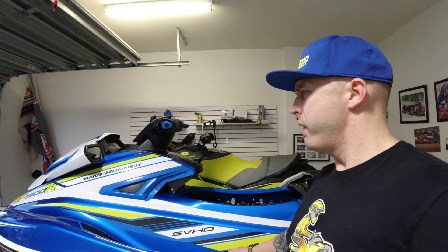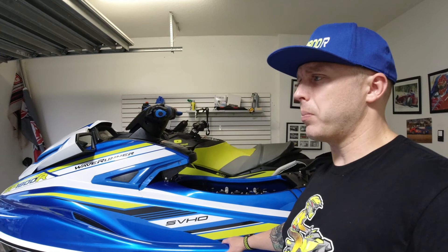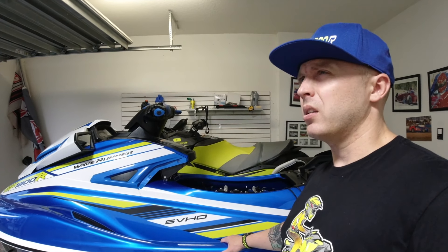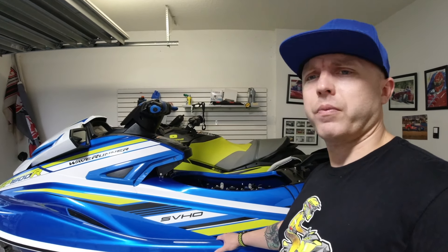In stock, these things run 68 miles per hour. It'll run 77, and then it raises the RPMs up — I think it's 8,300, and around 7,000 is what the stock RPM is. It's a lot of things to remember. Anyway, it's going to make it faster.